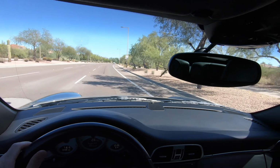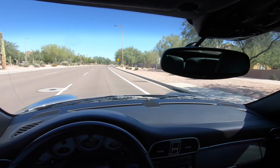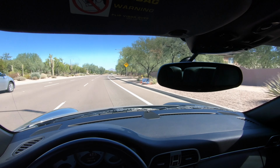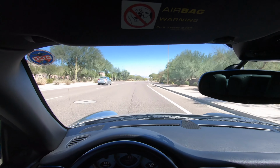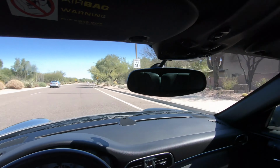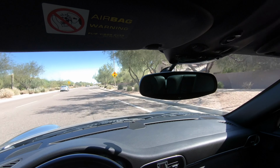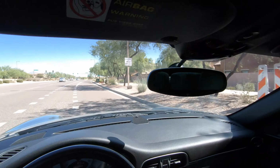So I did take the car out for a test drive after putting the engine mounts with the Loctite 38 polyurethane in, and it did feel a little bit improved over the stock engine mounts, and there wasn't any increase in noise, vibration, or harshness. After that, I took the engine mounts that I took off and I filled it with the 3M window weld, and then I swapped the engine mounts out. Let's go ahead and take a look at my impressions from that drive.